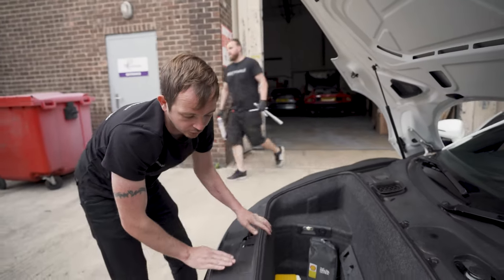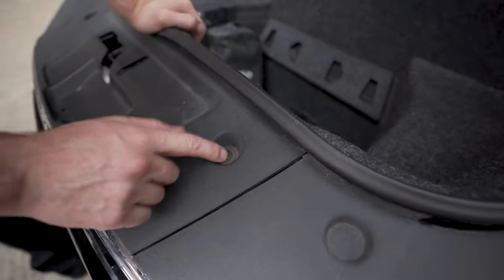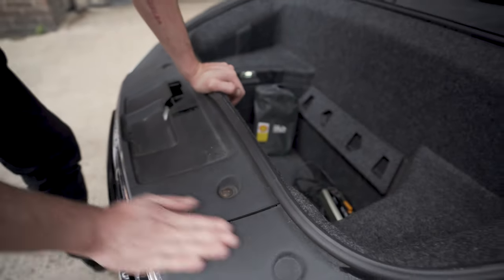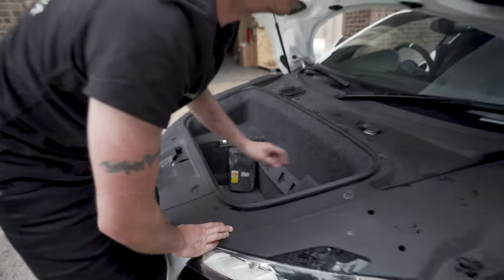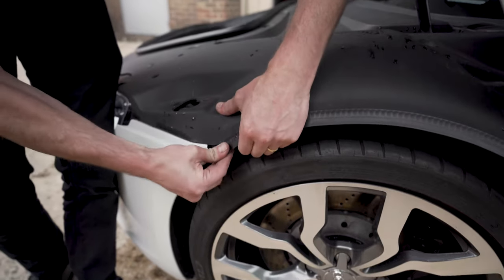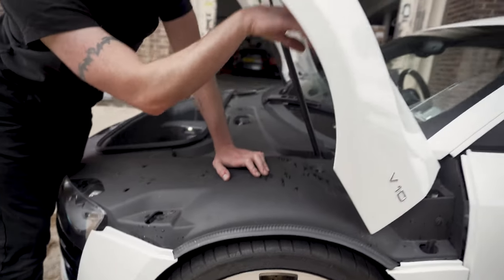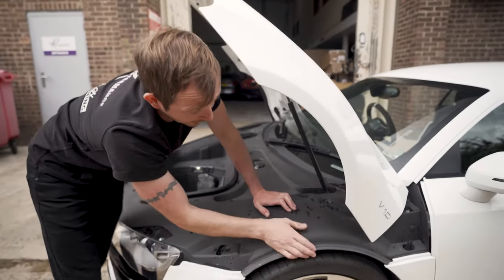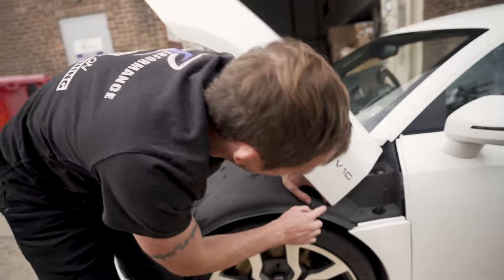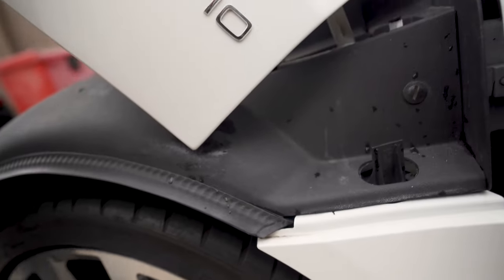This is pretty common where they start to corrode. They're expensive to change. They're like £5 a quarter turn screw. But just make sure the clips and the trims are right. These go missing for fun. These are arch liner seals, and what they stop is everything coming up the wheels going up the inside. So make sure they're there. They're like 15 quid each. You can tell if someone's been a bit playful trying to get them on and off. Can you see all that gouging there in the plastic? It's a bit wet. Should I dry it? You know what I mean?